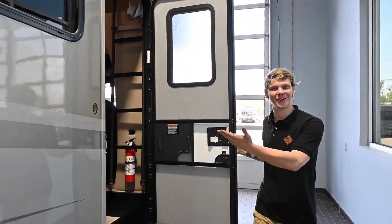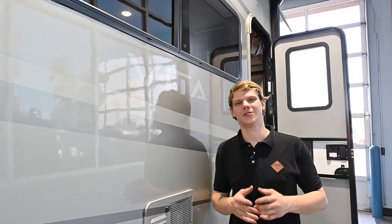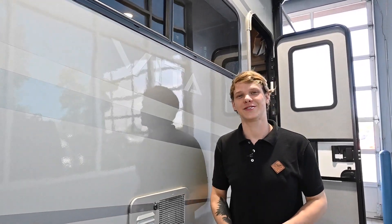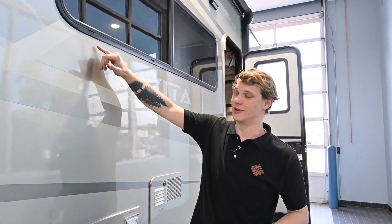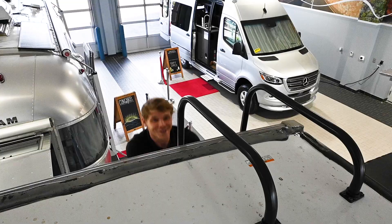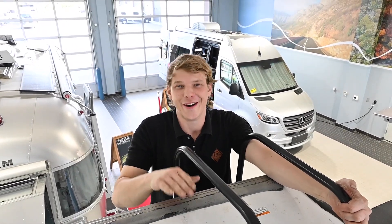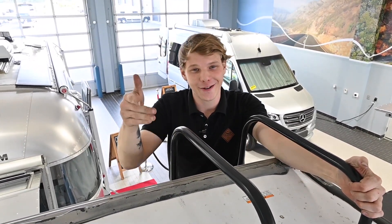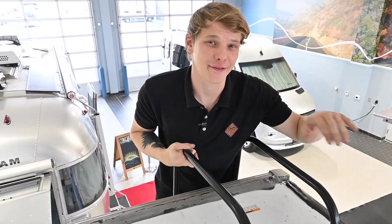Let's start on the outside. Your Winnebago, like this beautiful Vita that we have here, is built with precision and care, boasting an exterior designed to fend off the weather elements. Still, as resilient as it may be, it requires regular maintenance to keep moisture-related issues at bay. Pay particularly close attention to windows and doors to check for any signs of cracking or peeling around the seals. Also, don't forget about your rooftop — carefully using your ladder, get on top and check your seals and edges wherever you can, especially before and after storage.